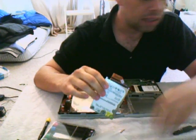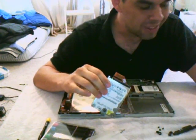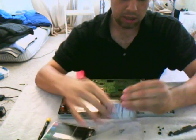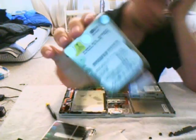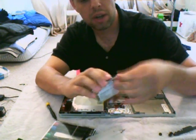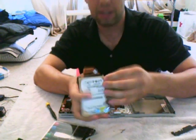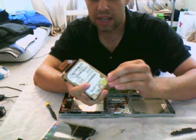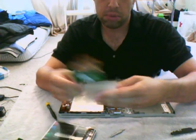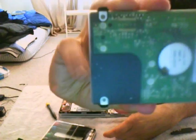Dig out the four grommets and the four stubby black screws you took out earlier and put those back in. Once all the screws are in place, put the grommets in — flat side towards the drive, which is self-explanatory once you get it out. There's a small side and a larger flat side. Line this drive up with the housing — it only goes one direction. There should not be any excess hanging off your drive; it should fit just like this with nothing extra on that side.